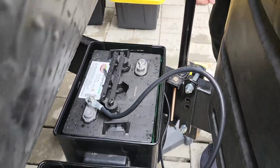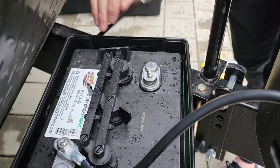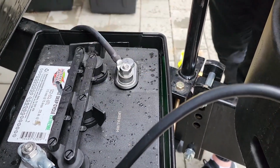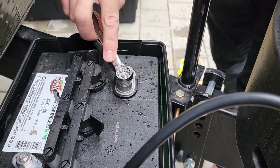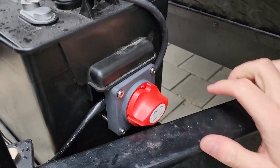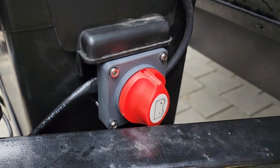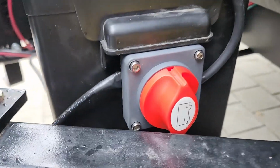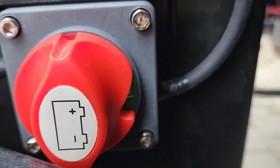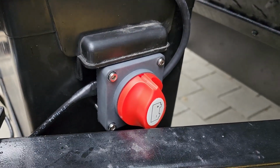And finally, now from your switch, that negative cable from the switch onto the negative on battery 2. Now it's all connected, it's off, and you just rotate it, turns on, and remember, it's coming from the ground wire from the RV to the switch on the left side, out the right side, back to the battery cable.